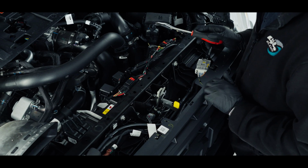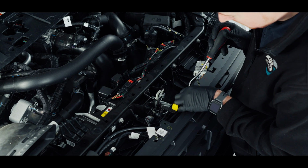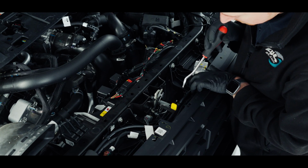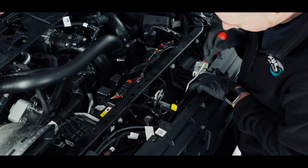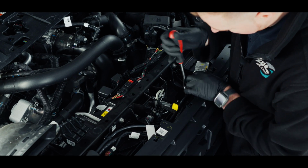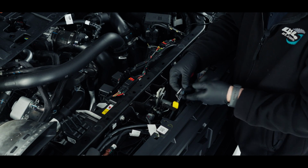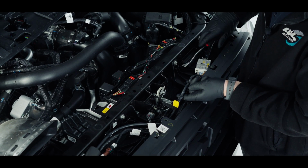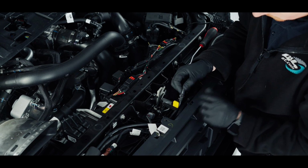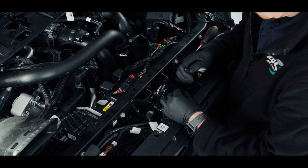To remove the camera jet wash connection, we're literally going to put a trim tool in behind this plastic clip here. Wiggle him out. And then we have our connection here. I'm just going to squeeze in these 2 tabs to release that.